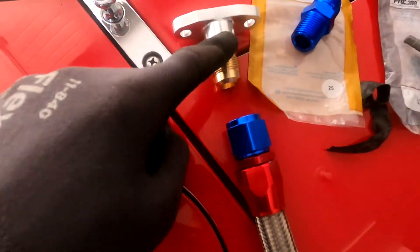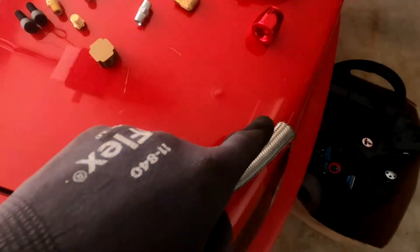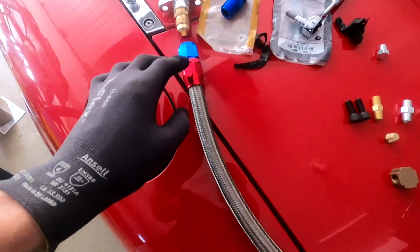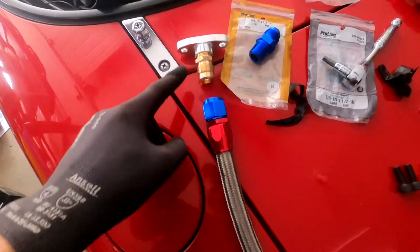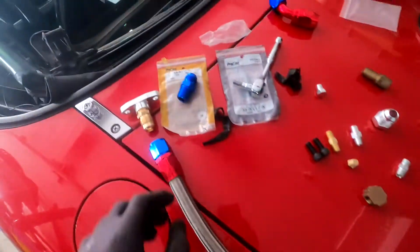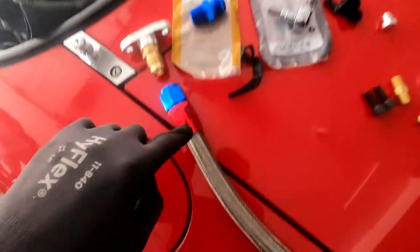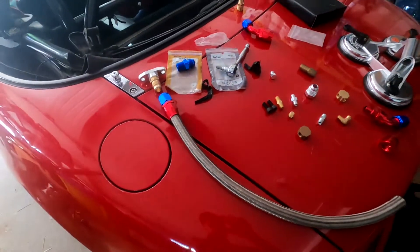That fitting's all on there and ready to be attached. I was going to do that and get the fitting on the other side, but this oil line is actually a little bit long for my car. I'm going to rough fit this over on the turbo on my car and see how long this oil line is going to be, then tap the oil pan, put this fitting in, cut the line down, get the fitting on the other side, and finalize everything.